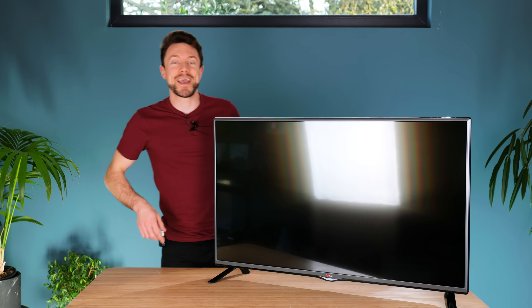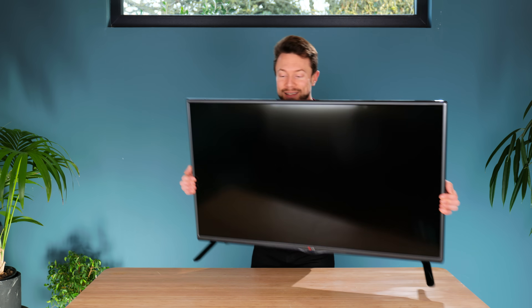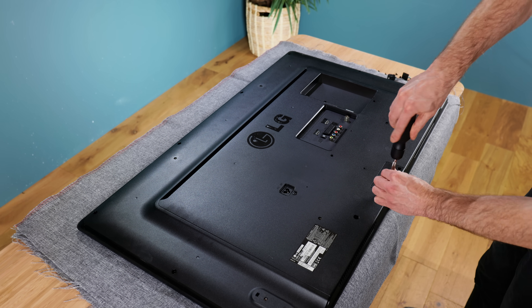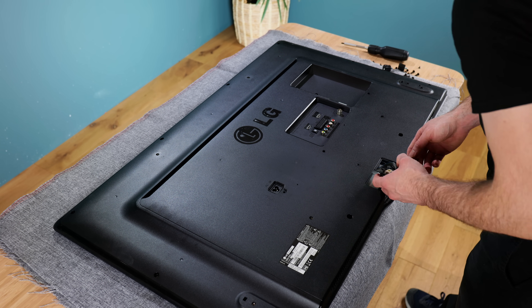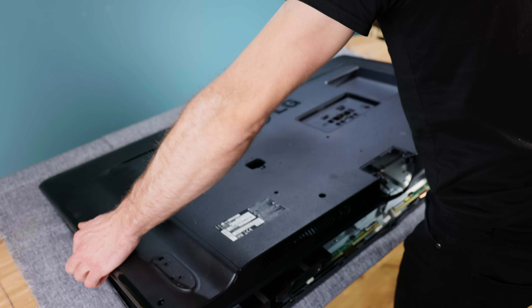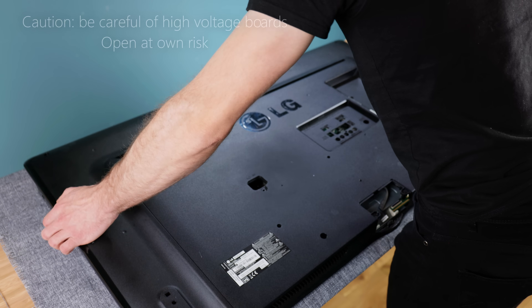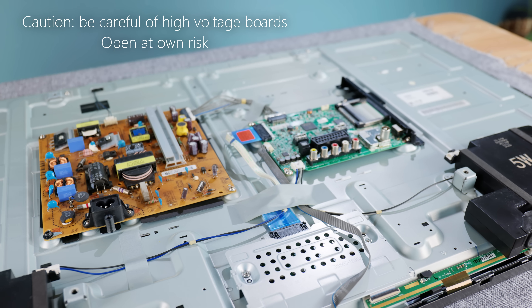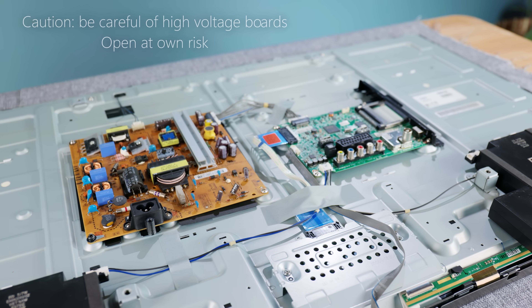To get at the LCD panel inside, we'll place it on its front. The plan is to extract all of the internal components and install them into a custom frame that features a completely open back so that we can project light directly onto the rear of the LCD panel. There are surprisingly few components inside — just a couple of PCBs and the speakers — all of which need to be carefully removed so we can use them later.